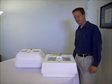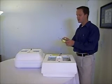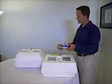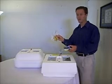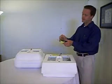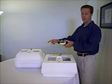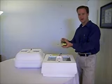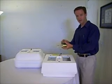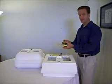We mentioned it's a mechanical thermostat. It looks like this — it's a wafer style. When you get this, you're going to get it in a small packet like this. It does not come installed, but installation is very, very simple. Set it into place in the metal bracket inside the Hovabator incubator, screw the wafer into place, set the lock nut at the right spot to set the temperature as we talked about in the last video, and you're set. It's really that simple — not a big deal to install that thermostat.